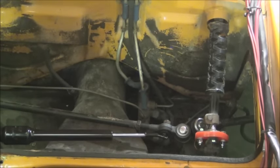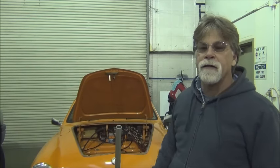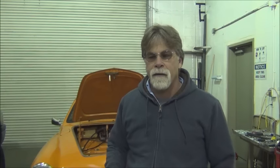Now what's left to do is put our cover back on under the bonnet, put the anti-sway bar back on, and put the wheels back on. But before I do any of that, I recommend that you move the wheel from lock to lock a couple of times — make sure there's no binding, make sure everything in the wheel and all the geometry turns freely. Then you can put everything back together. And once you've got everything back together, I recommend that you go directly to an alignment shop and get this thing aligned. That's your next step.